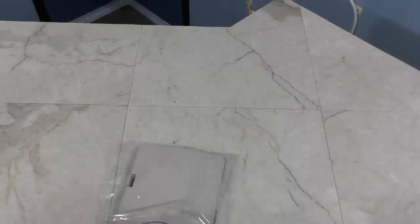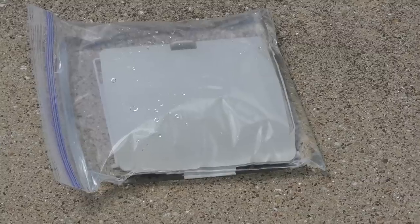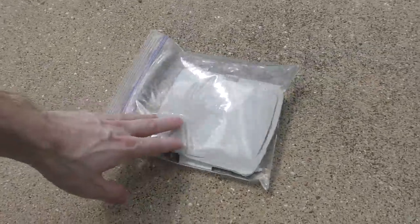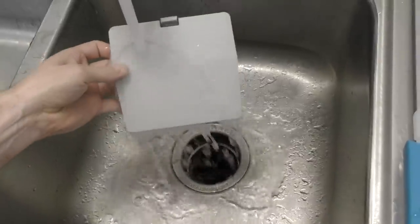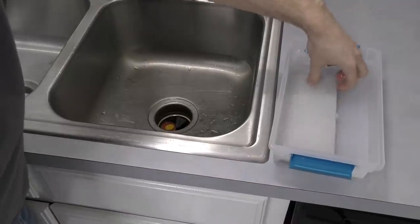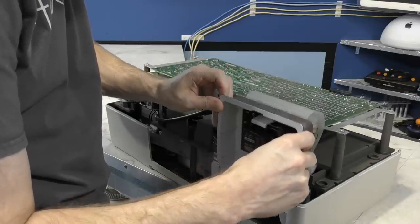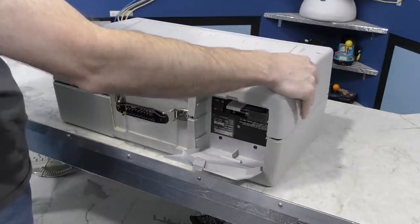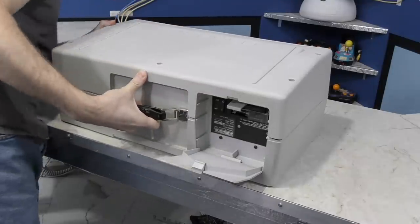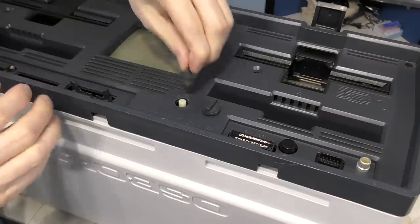It's no secret that the best way to do retrobriting — at least with all of the methods currently known — is total submersion in hydrogen peroxide. The problem is with the larger items you need a really big container and quite a bit of hydrogen peroxide, so it isn't really feasible. But I thought I'd test these smaller pieces and see if I could fix the damage. The bag started leaking, so I eventually switched to a little container. After a few hours in the sun, I rinsed it off and you can see this piece definitely looks better — not perfect, but better. I think that proves it's possible to reverse some of these streaks in the future when I develop a better method for handling these larger pieces.